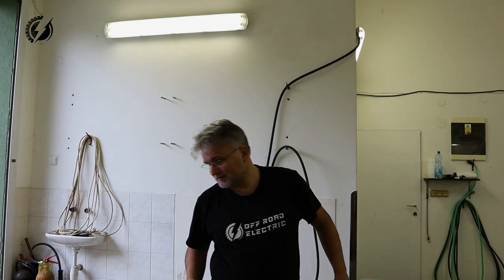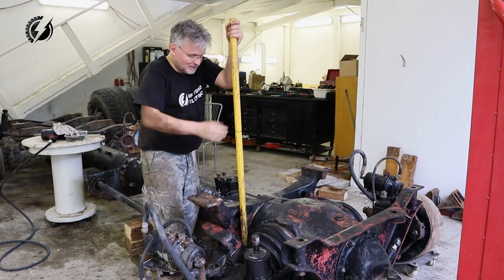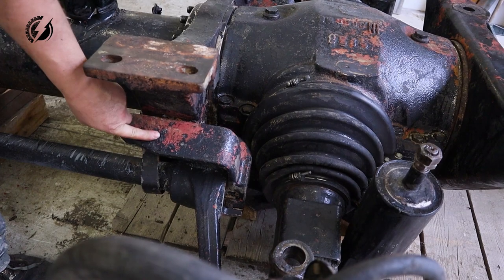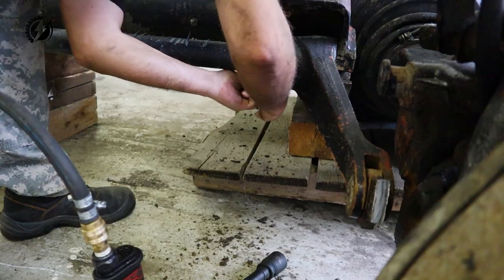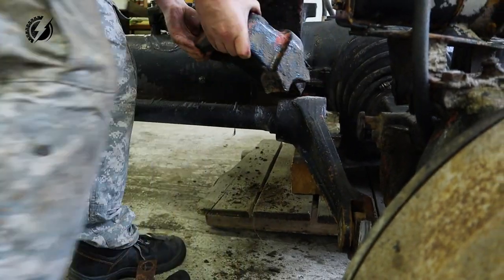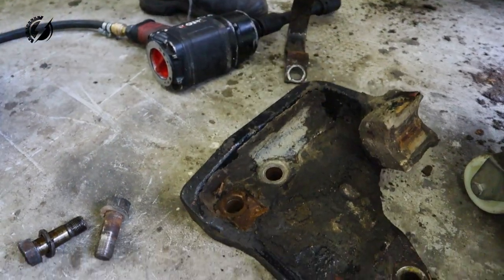There is no sign it's going to come apart — this will be interesting. This axle is approximately one ton, just my estimation and the estimation of others. The axle doesn't show any signs that it will come apart, so I'm going to remove the suspension bracket here. In that case the crossmember will be free and hopefully something will happen.